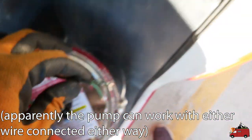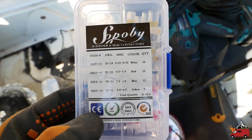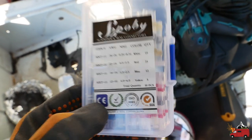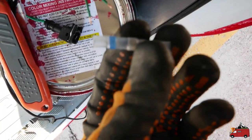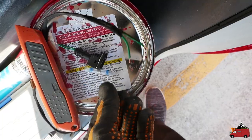I did the same thing on the other end — you can see there's a purple, or it looks black, line. To reconnect these I'm going to use these solder seal connectors. It's a 16 gauge wire, and what you do is put the wire through the connector, take a little torch to it, and it will solder and heat shrink the wires all in one step.